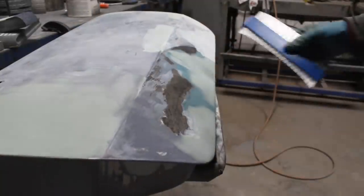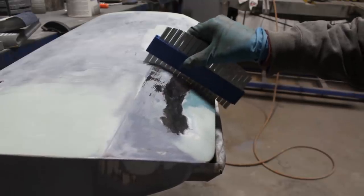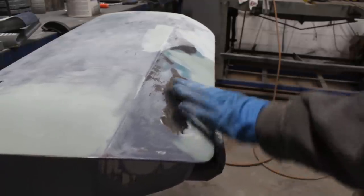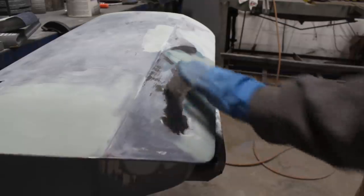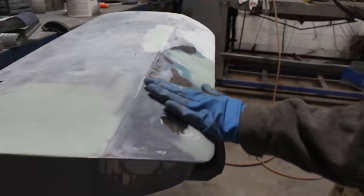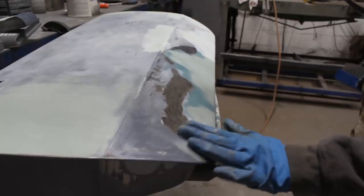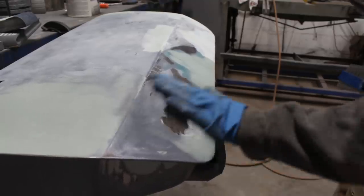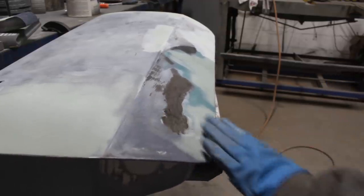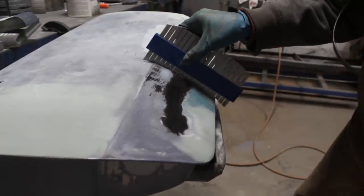Right, I think it worked great here now. I think we are perfect now here. It took a while. You have to shrink a little bit here, a little bit there, then a bump remains somewhere, so you find it and shrink it. The good thing is that the disc is flat, so it finds the high spots automatically on its own. I think here it is still a little bit too high, and I need to sand it now, because my body filler here is too high. But I'll finish with shrinking first, and then I'm gonna go back to sanding.